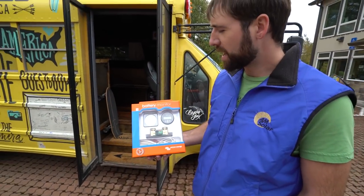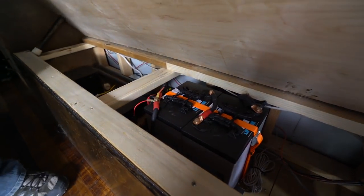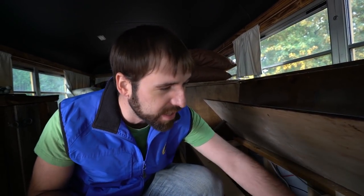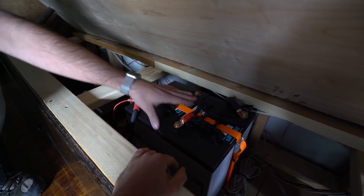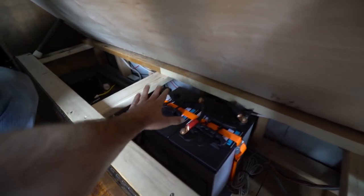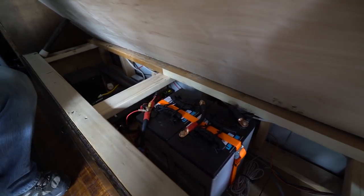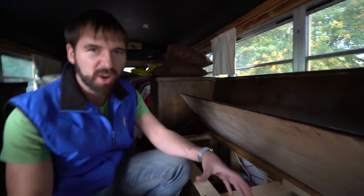How much can you get this for approximately? It's like $200 and something. This is what happens when you toast your battery — you have to buy new batteries. So what are these exactly? These are GPL 6CTs — two 6-volt batteries, each 300 amp hours at 6 volts. Together you get 300 amp hours at 12 volts. When you join them through series, you double the voltage but keep the same amperage. They're each individually 300 amp hours at 6 volts, so we doubled the voltage but not the capacity. They're a little bit bigger — about 50 amps larger than his last battery, the 8D, which is also AGM, same company. Nice quality, but a different golf cart style battery.